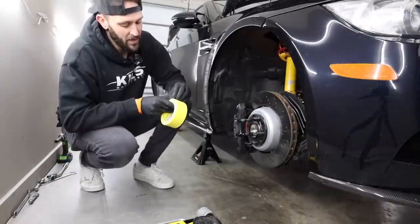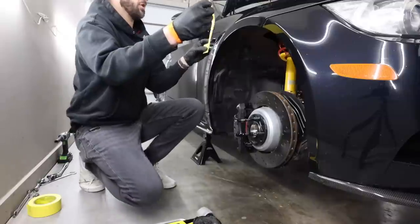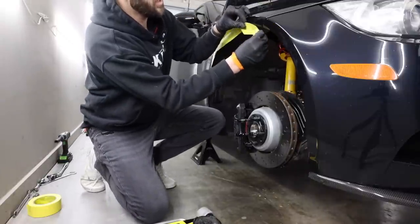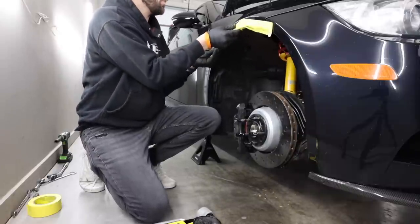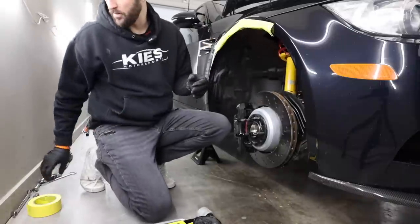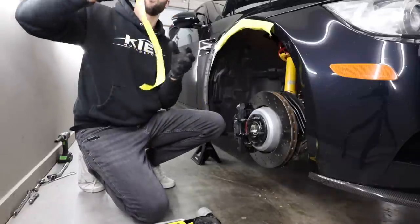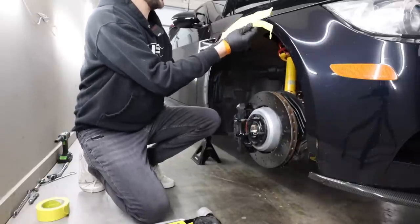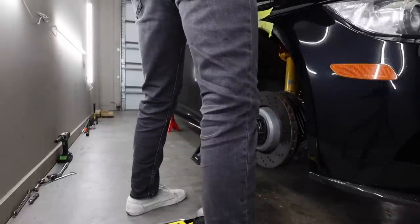When you pull this out, depending on your suspension, you could have a suspension that is just beat like mine, and you're gonna have all of the room in the world to remove it and not hit your fender. Or you're gonna have a super compressed spring that is gonna be a little bit taller, and it's gonna be a nightmare to pull out. Either way, it'll be very close to the fender. So just as a precautionary measure, tape up the side so you don't nick your paint when you're pulling it out. Again, I'm removing these top strut nuts, these 13s, all the way.